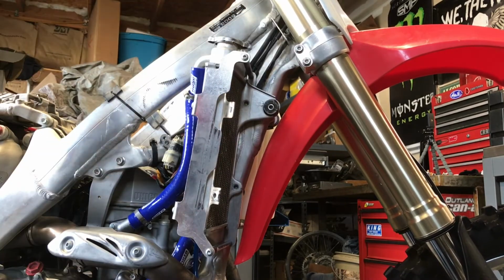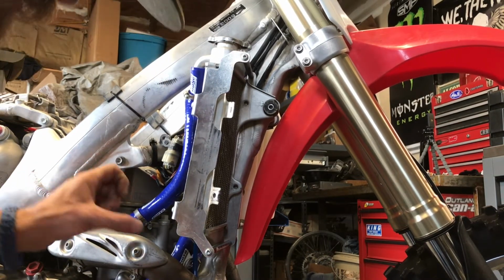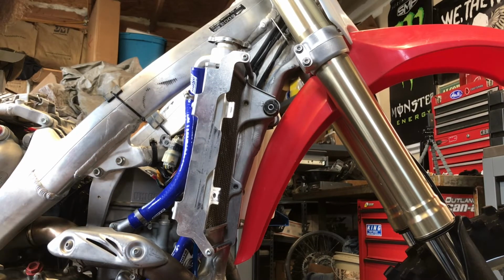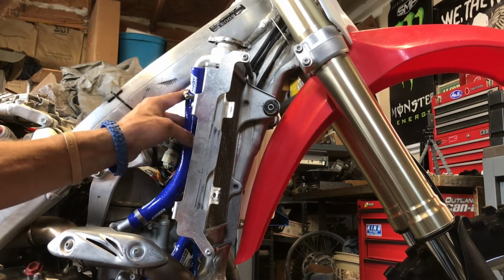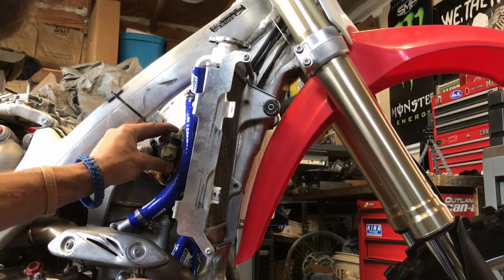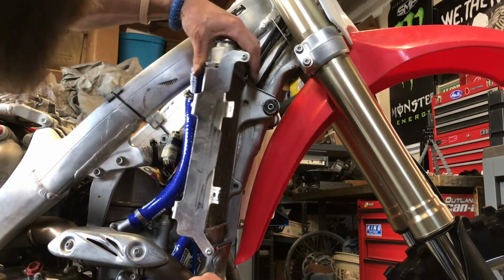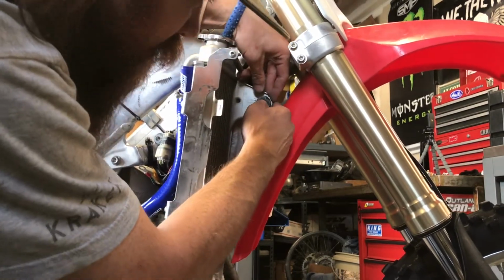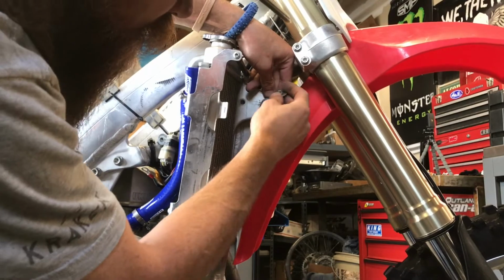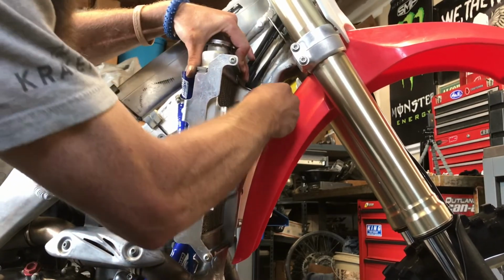We're going to tighten all these clamps down when we get this radiator on, because I kind of don't want this bottom hose touching anything. So I'll twist on whichever side I feel is needed. Same with this top one. I'll probably do the same thing here, twist out a little more, once I get this bolted back up. See how close I can get. But for now, let's focus on the main fight at hand: getting this radiator lined back up to go together.